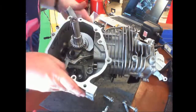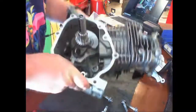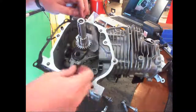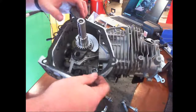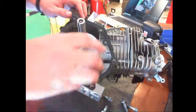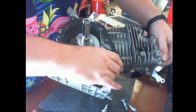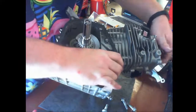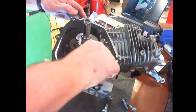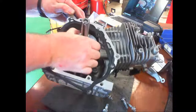There we go. All right. That's much better. I'll put the gasket back on. You guys, remember, what was the torque for the side cover? You guys should have this written down. 10 foot-pounds. Awesome. Oh, gotta move the push rods out of the way. That way the tap is all the way down. And I need to make sure what's what.